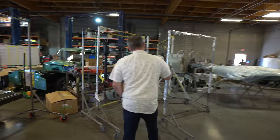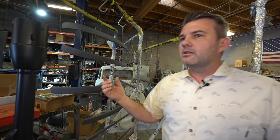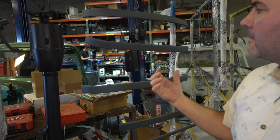Let's go talk about this truck here. All of these have been Cerakoted — I believe it was a transfer gray or similar color, an air-dry Cerakote. What we did was blast everything in the blaster, clean it all with acetone, let it sit, then put it in the booth and shot it all. It takes about five days to fully cure — it's been a couple of days so it's dry, but it needs to fully cure. And then this is going on the '49.